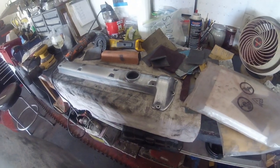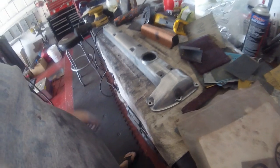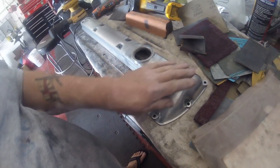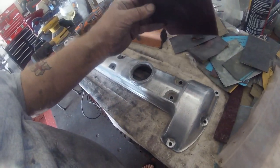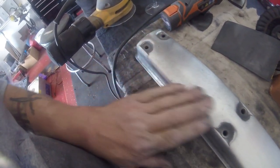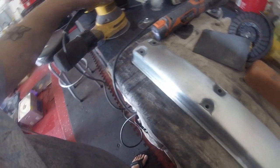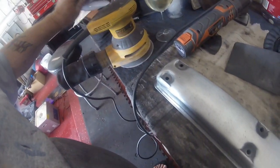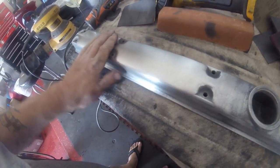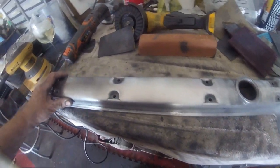I know I promised it would be the next video, but I've been working on this and just wanted to show you one of the stages. You saw the covers before, how bad they were. This is with a light sanding — I've gone over this with 400 grit wet and dry paper and also a quick rub with Scots cloths. Down here I've taken it to the next stage — I was using 1000 grit but it didn't really take it down as much as I'd like, so I got my orbital sander with 220 grit, taken it down to that level, then went over it again with 1000 grit. You work it up — 1000, 2000 — as you need to for your particular project.